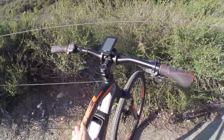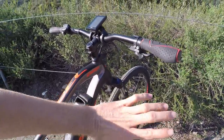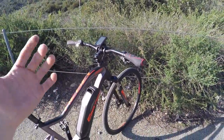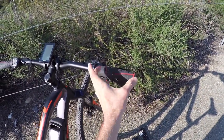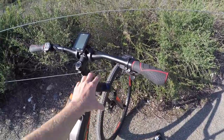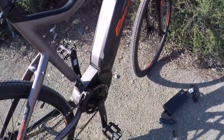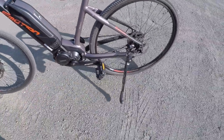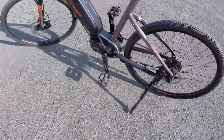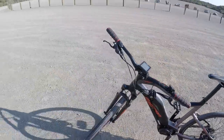One of the other things I really appreciate about the Rebel Cross and a lot of the EZMotion bikes is that they have a sealed bearing headset. It's not going to creak, it's not going to rust over time. It's an area where they could have gone cheap, like these grips where they spin and stuff — but grips are cheap to replace. The headset you want to work, and it's something you can't really see as a consumer, so it's nice to know. And then sealed bearing bottom bracket down here, even though it's square tapered — that's fine for a bike like this. Where the kickstand is mounted, it stays clear of that left crank arm. That was my gripe about the battery charging port position.